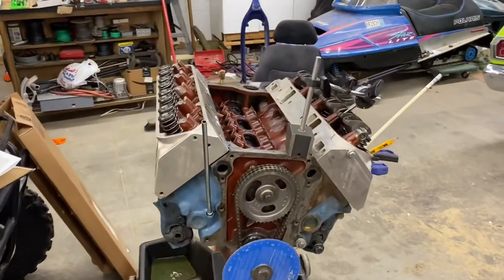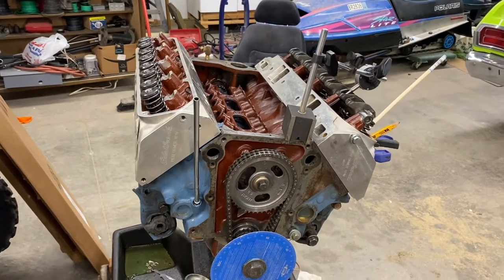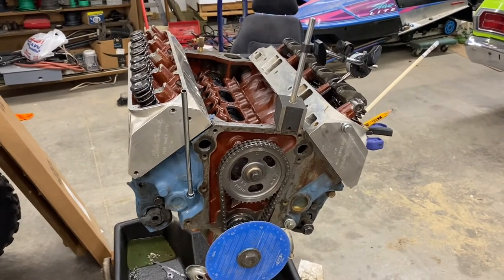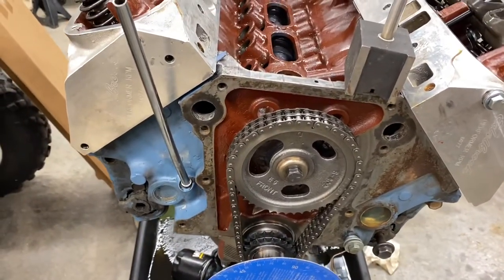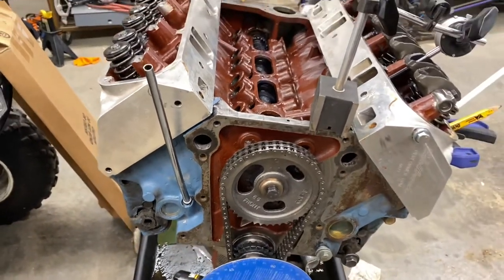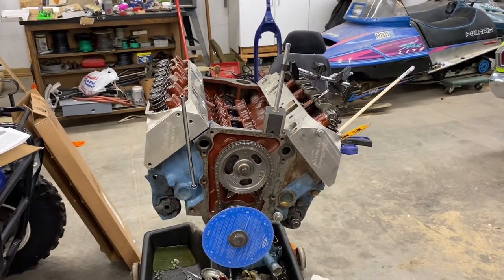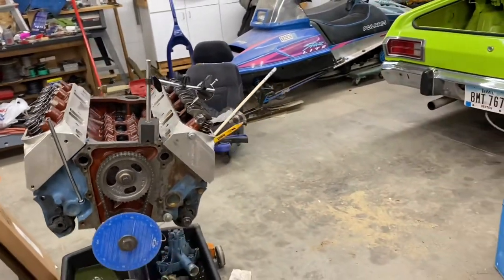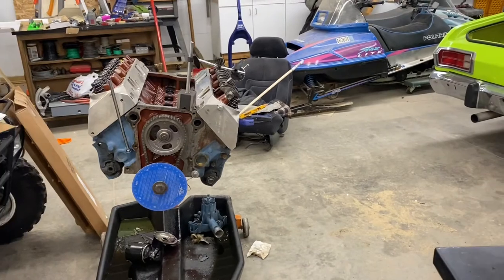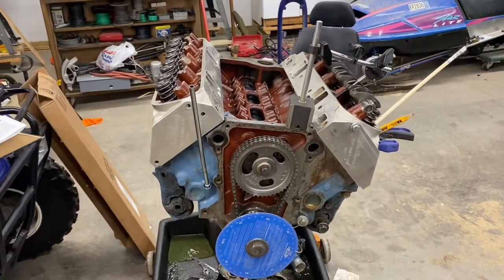The manufacturer of this camshaft has a recommended cam timing, and you can alter it. This timing chain setup has a four-degree adjustment — advanced and retard — and you can adjust that to suit your needs. I want to run this cam straight up, which means I want to follow the manufacturer's marking. They're calling for 14 degrees at 50 thousandths before top dead center, so knowing true top dead center is more valuable than trying to guess.